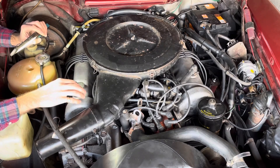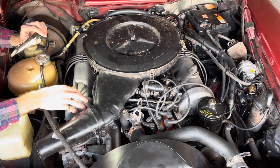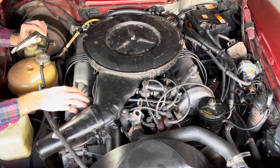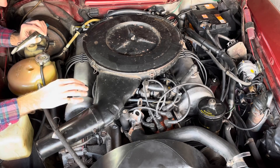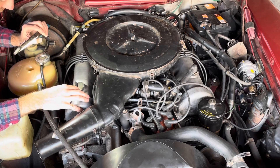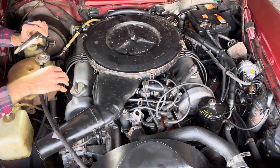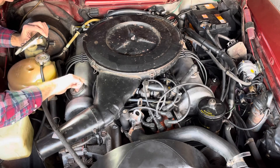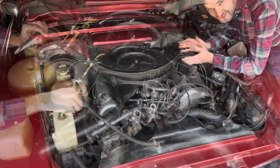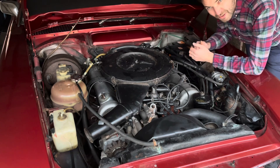Another thing to remember about the early cars is they have mechanically adjustable valves — in theory they should be adjusted every 12,000 miles. It's worth doing: maybe every year at service, or every other year depending on mileage, pay for the extra hours of labor to have the valves adjusted. The car will run a lot better as a result, and it's something frequently forgotten on the early cars because most R107s have the later hydraulic lifters — but not these ones. That's really the long and short of it — fuel delivery system, timing chain, there's not a huge amount else to go wrong under here.